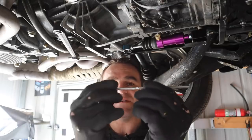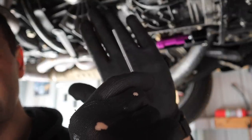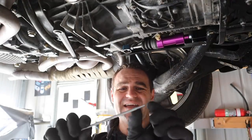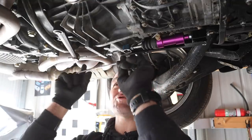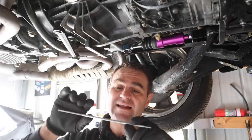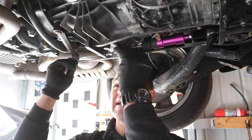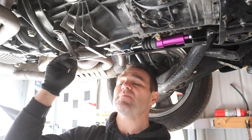So I've got my piece of rod, and I've threaded both ends. I've done a lot more thread on this end here. I've threaded this end all the way through — this is going to be the end that goes through the arm itself — and then just a small amount of thread at the top. The reason I didn't go and buy just a piece of all-thread is because when it travels through the hole in the gearbox, I'm worried it's going to act like a saw, same as what the cable would do. What I'm going to have to do is bend this rod so that it travels through nicely. The pull will still be straight, but it just needs to pull so it will travel through that hole, and that looks like it should be pretty decent.